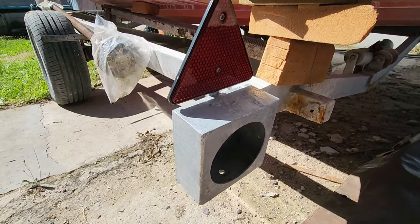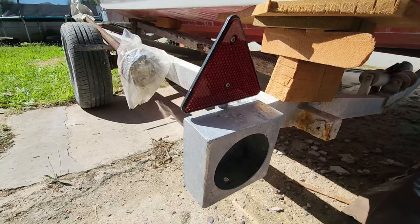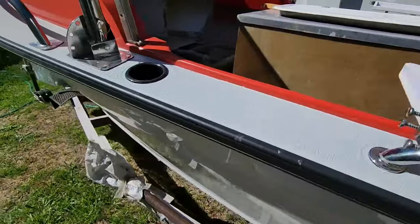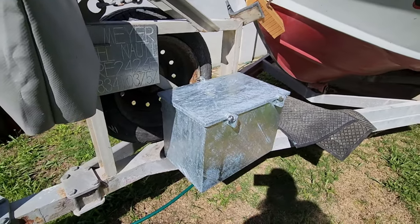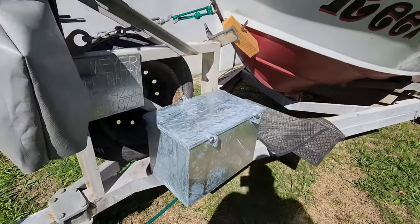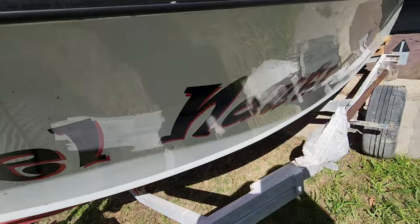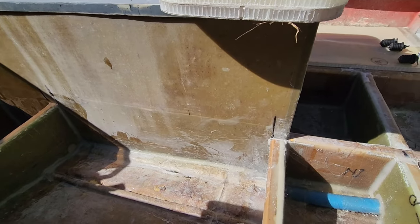I've also made two steel boxes and had them galvanized so we can have tail lights permanently on the trailer. I'll do my best to keep them as watertight as possible — the lights going in there are waterproof. I also made a galvanized box to put the battery in for the winch we added a couple of months back, so it'll be able to take either one big battery or one smaller battery, and I can also store ropes, pulleys and all that type of stuff in there.